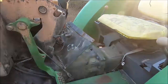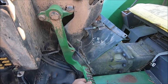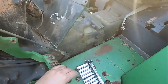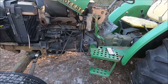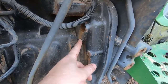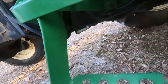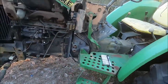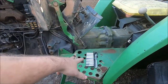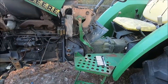I don't think adjustment is our issue. Pedal free play looks good — about a half inch before it actually starts engaging the clutch. I think we're going to have to split this and take a look. There's an access cover here missing, and I'm just hoping stuff didn't get down in there. Both linkages move when you move the clutch pedal, so I wondered if there's some kind of binding issue going up in there. There's no access plates back where the linkages are, so there's no way to know unless you take it apart.